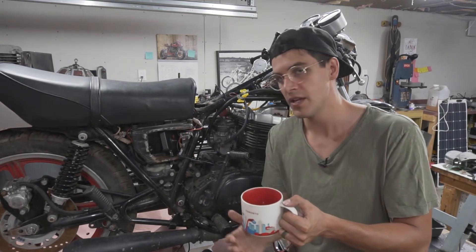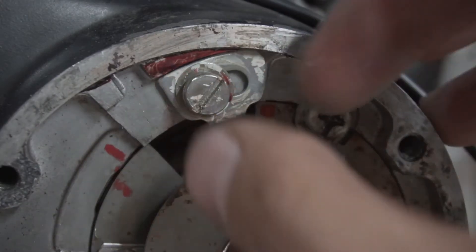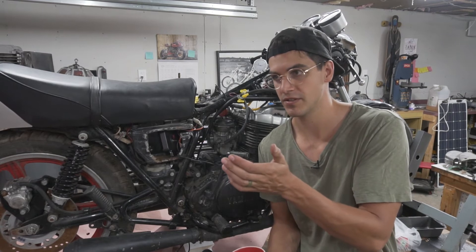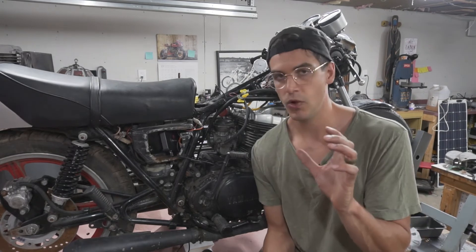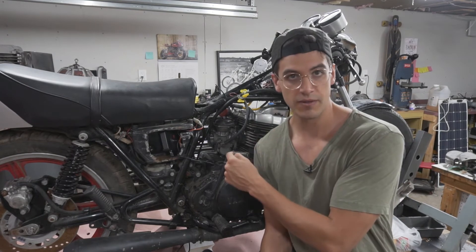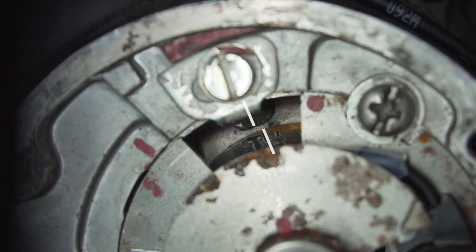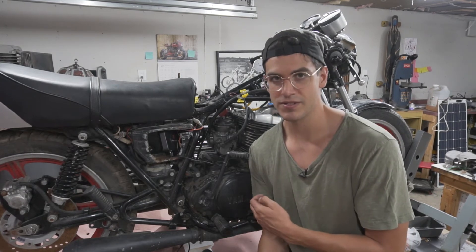I took it around until the dial started going down again, and then I went back up and kind of went back and forth until I figured out exactly where top dead center is. The reason I was doing this is because the top dead center mark where the timing marks are is adjustable. On some bikes it's not adjustable, which makes sense because it should never come out of adjustment. If you know of a way top dead center could come out of adjustment besides significant damage to the crankshaft, comment down below. The whole point was to recalibrate the top dead center marker to be at exact top dead center so I could use that as a reference to set the timing pretty close to perfectly. When I got the piston at the real top dead center, I checked the timing mark and I realized it was off by a hair — I don't know if that's enough to make the motor not run, but it's good to know it's exactly where you need it to be.